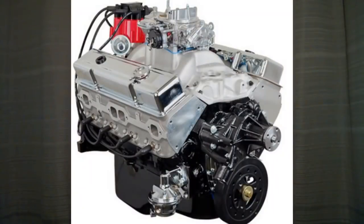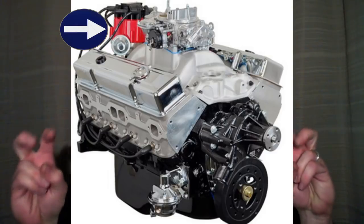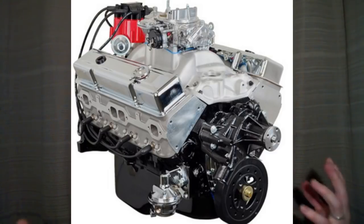After a long block, that would be either a complete or sometimes called a turnkey engine. That's kind of a misnomer as well, because not all turnkeys are going to come with everything you need. They may come with your distributor, spark plug wires, spark plugs. But sometimes a complete might not have an air cleaner assembly or valve covers. Usually a complete is going to be the closest you can get to just bolting it in and going, and that applies to a diesel or a gas engine.